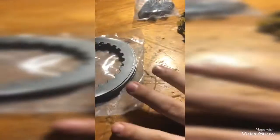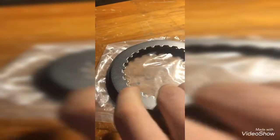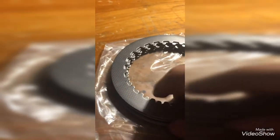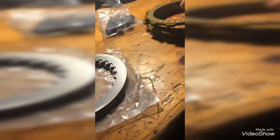Go through every single part that you get. Also, this clutch is just a temporary clutch — I will be buying a really nice Hinson complete clutch with the basket and everything. Make sure you guys stay tuned for that. I will be doing a complete rebuild on the bike — not a bottom end rebuild, but definitely rebuilding the transmission because third gear is most likely completely broken. It's not getting any power at all, almost like the clutch is slipping, but we know it's not the clutch.